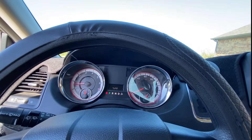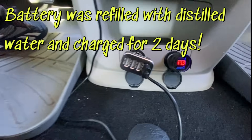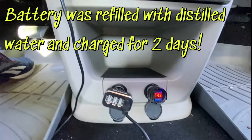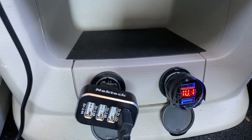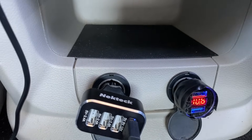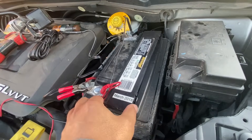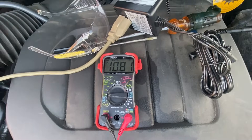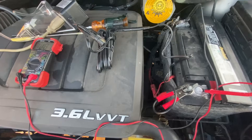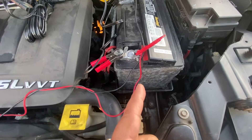Today was my very first day driving the vehicle after charging the battery for two days. I hooked up a digital voltmeter inside and after turning off the vehicle and coming back in 10–15 minutes, just rolling up the window dropped the battery voltage to 10.6 volts in less than one minute. I decided this battery is toast. All the cells were full, but it was only charging up to 10.81 volts. I swapped it out for an AGM because Texas heat kills lead-acid batteries, and it did not survive its first winter.